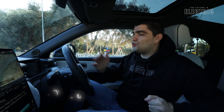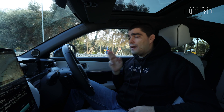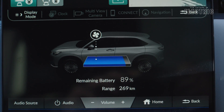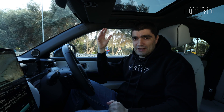You might have heard that with EVs it's generally recommended not to charge to 100 percent. Well with this car things are a bit different. It has a 68.8 kilowatt hour battery pack of which 61.9 kilowatt hours are actually usable, meaning there's already a 10 percent buffer on battery capacity. So even when your dashboard shows 100 percent state of charge, the battery pack itself is only being charged to 90 percent. That buffer improves the longevity of the battery pack.